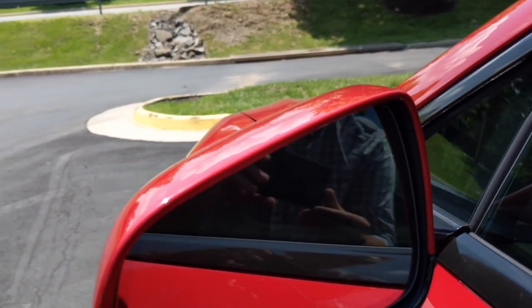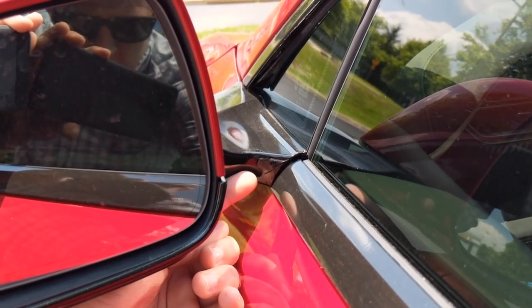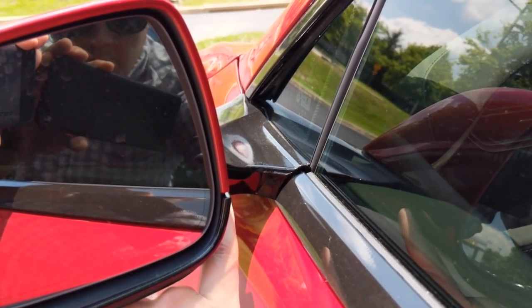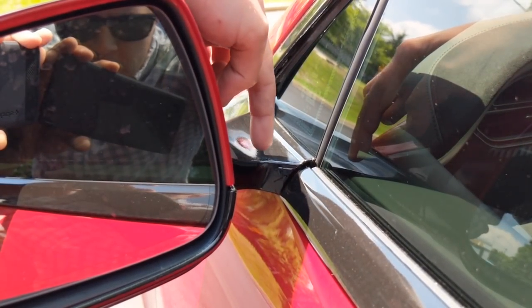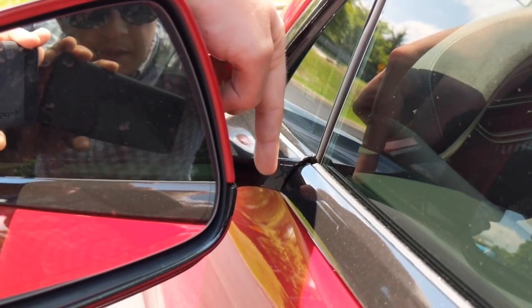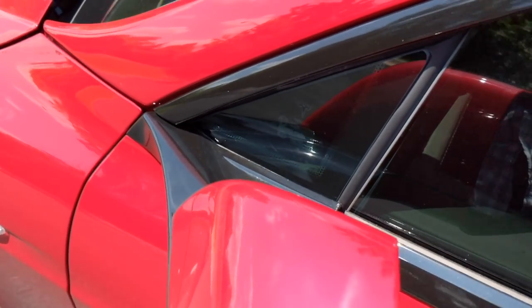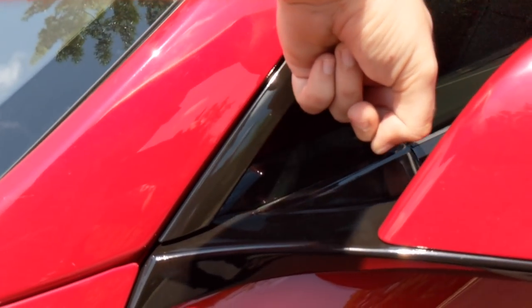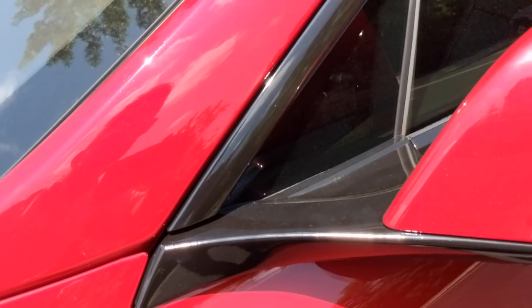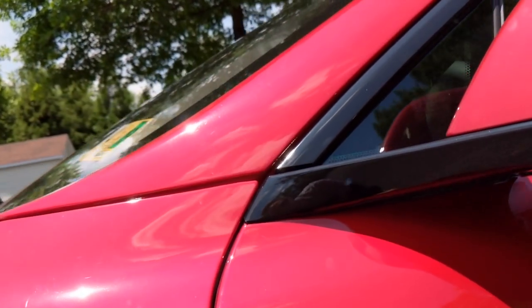Wrapping the back side is pretty tricky. I took the under piece, wrapped it up to this edge and cut it off all the way up to here. I took the top piece, wrapped it down and met it right at this edge. We'll see how that holds up — I didn't give it a whole lot of overlap but I think it'll be okay. Use lots of masking tape — mask off this piece of window. Vinyl sticks really good to glass, so it's hard to tuck it into this edge if it's constantly sticking on that glass. Lots of masking tape on here so you can really push underneath that edge.